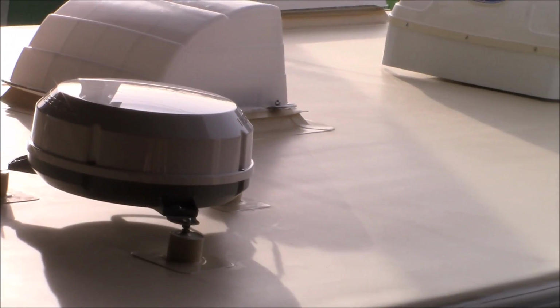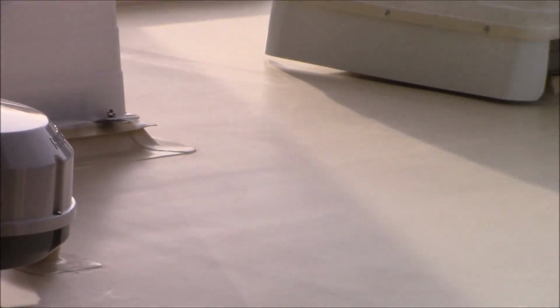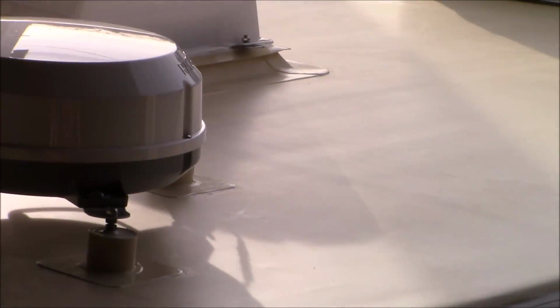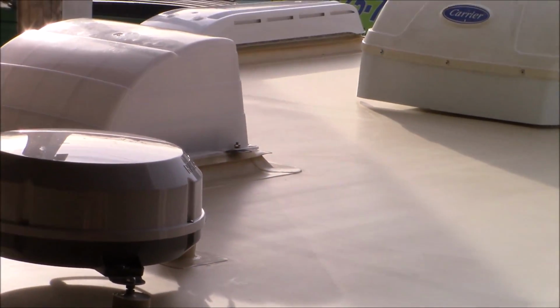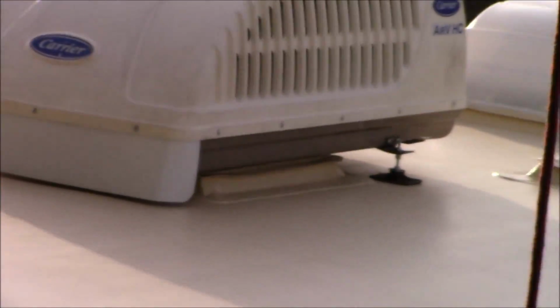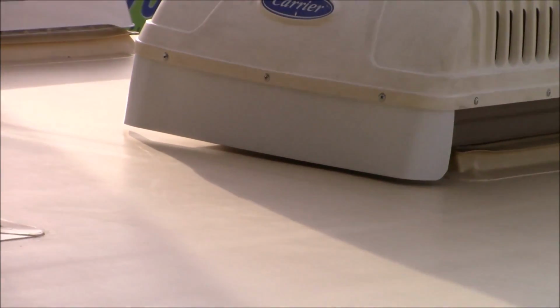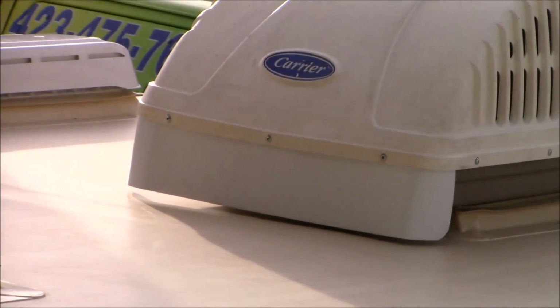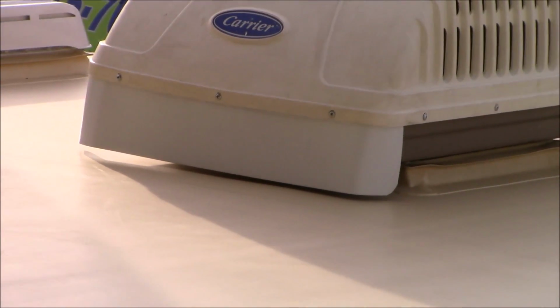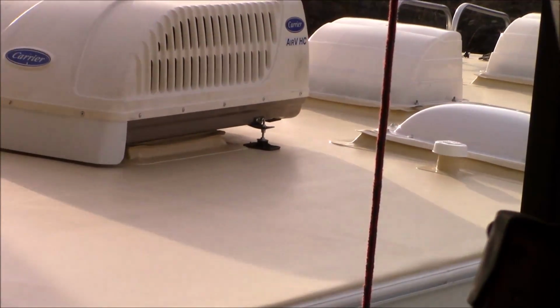And then everything is all heat welded. All those boots are all heat welded in there. Everything's all heat welded. There is a heat welding video on our YouTube if you want to watch it. Just go to our channel and type in heat welding. And then on the air conditioner, we've got the stands that we fabricated in the back right there. It just gives us some balance. And then we've got this front counter flash. The purpose of that is to make sure water doesn't come down the cover and try to get back into the foam gasket. That's what that does. And everything else is all heat welded the same way.